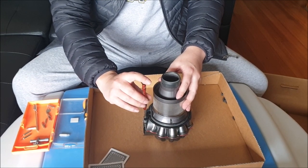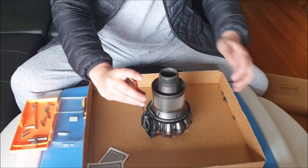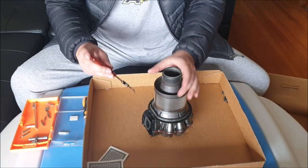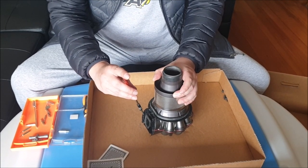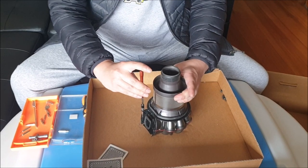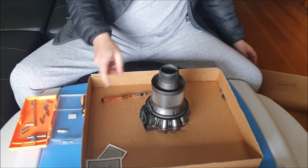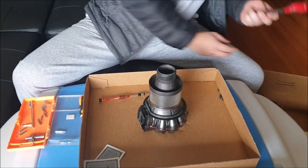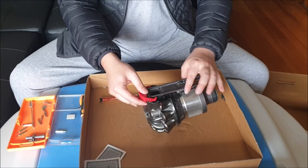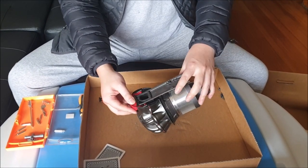We need to put the two screws on the side back, next to the guide rail. After this, you need to change the tip to a bigger one — I think it's T8. For the whole disassembly you just saw, we used a T6 and it was good enough. Now we need to put the guide rail back in — remember to put one side in first and make sure the rubber goes over it, then press the rest in.